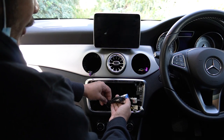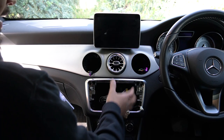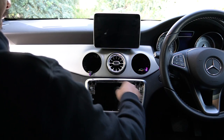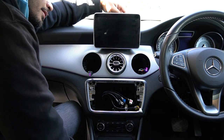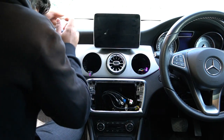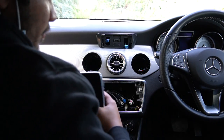When you pull all of these out, take a good look and note what you've unplugged — check the colors of every single plug. For example there's a small green plug here that isn't there on other units, so you can very easily mix up the plugs. Next up, the original screen — at the back there are two tabs. Use a pick tool to pop them open carefully, then there are two Torx 20s behind that. The screen lifts up and out, and you've got two plugs — the pick will come in handy with those too.